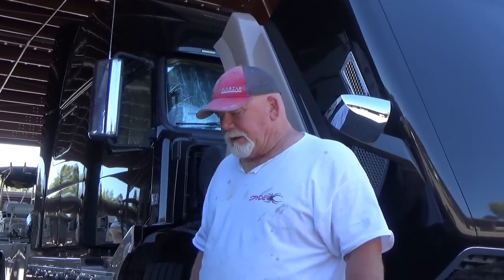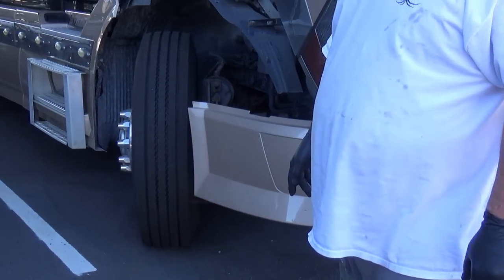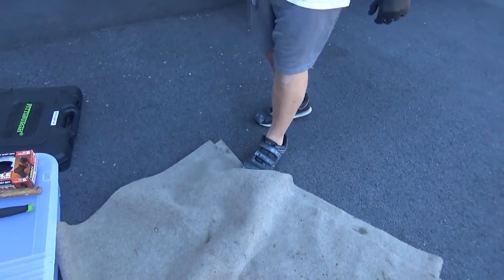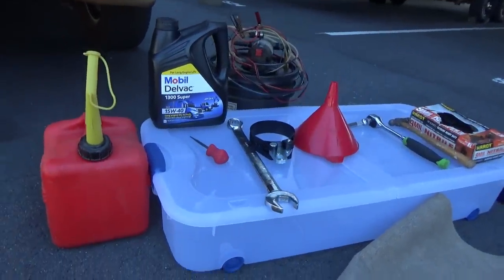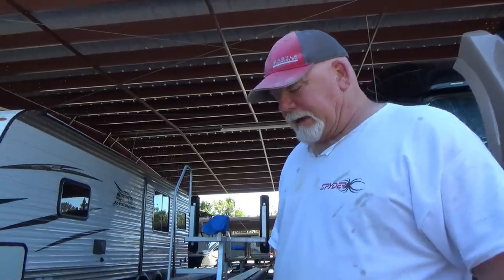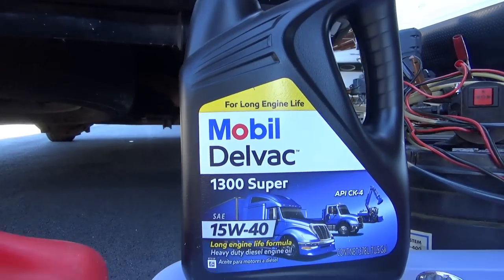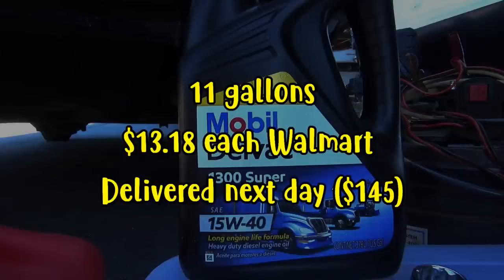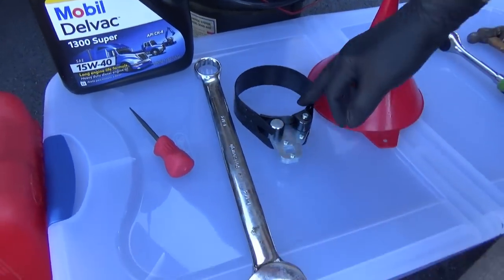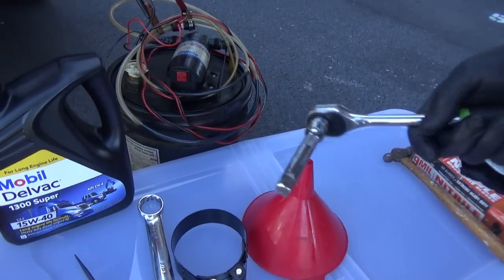So what are you going to start with here? First thing I did was start up Leroy and turn the wheels out to the right so I can get up in there and get to the oil filters a little easier. I got my rug — got to have that to lay on. I got this storage container, it's 66 quarts, so it'll hold the 44 quarts of oil. The oil I'm putting back in is 15W40, a synthetic blend. I have a one and a quarter inch wrench for the drain plug.